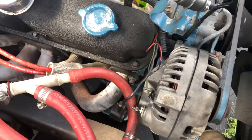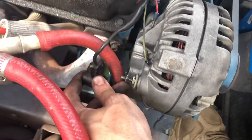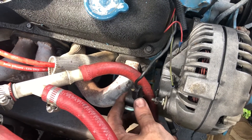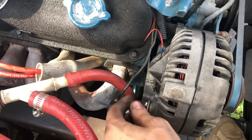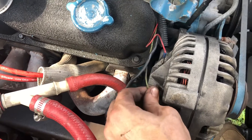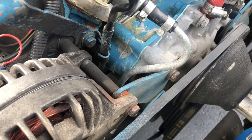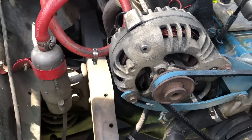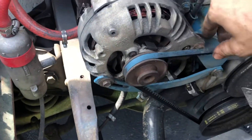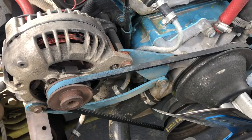The first thing you want to do is come around to the back of the alternator and disconnect all the wiring. I already did this one just because I wasn't sure about the bolt size. You're going to take this off — I spun it off with a 10 millimeter, but it's actually a little bit bigger than a 10 since it's standard. This one I want to say is three-eighths, and these just pull off. Then you're ready to take off the bracket bolts that go through the water pump. The tensioner bolt is a half inch and the bracket bolts are nine-sixteenths.